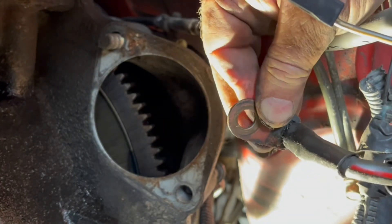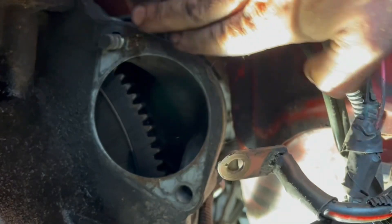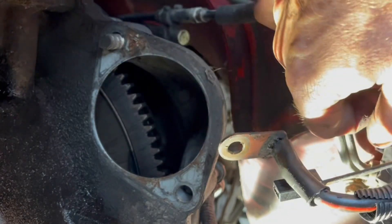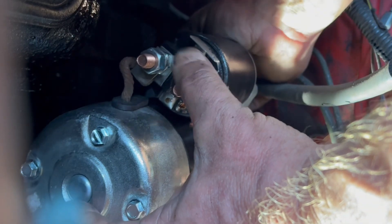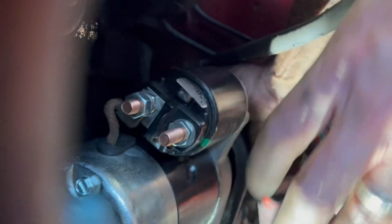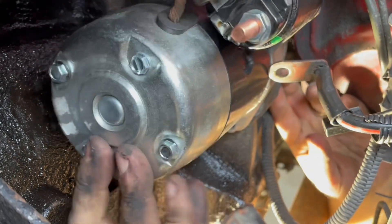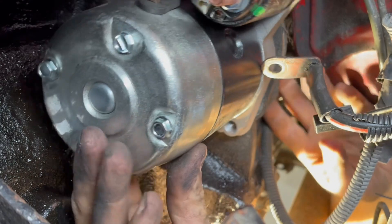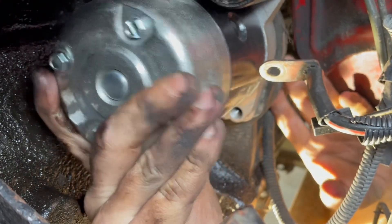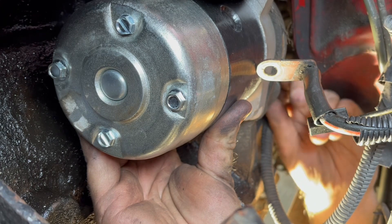However, if the terminal was corroded or really icky — or any technical term that goes along with icky — clean it before you put the starter in. Here's upper bolt, bottom bolt, and this has a shim plate or mounting plate, sort of like Fords do. I'm kind of having a go at getting this in place. I've got to try to get my second elbow through here between the torsion bar and the front driveshaft. This is short wheelbase so it's practically the rear driveshaft. The bottom bolt should be enough to hold it in place while I get the upper one started.